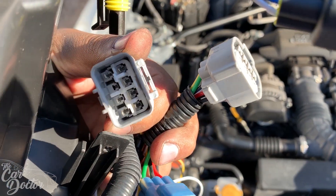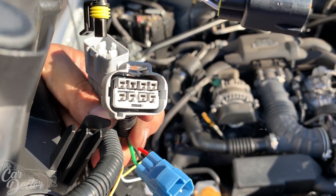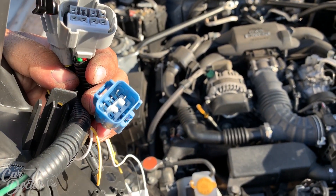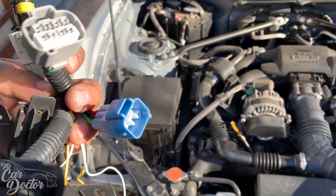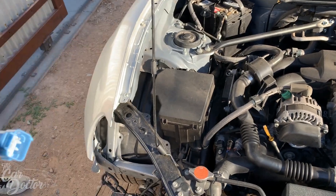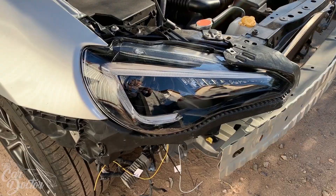The VLands come with an eight-pin connection, but luckily they come with a little harness that converts it from eight-pin to six-pin, so you can run them on either an FRS or a BRZ, or any special editions. They work with both, which is gonna make it much easier.